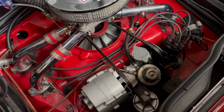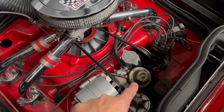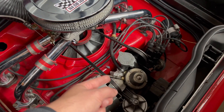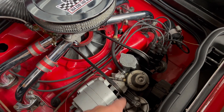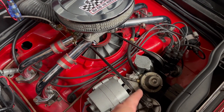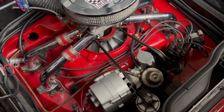The issue I have is that after two or three days this thing starts to squeak — a real high-pitched noise. I came to find out it's something about the oil or lubrication to the cam that pumps this thing. If I pull it apart and put some oil on the cam, on the shaft, on the lifter, the sound goes away for a few days, then it comes back. I don't know if there's an issue with the oiling to the cam or just an issue with this pump itself. Whatever — I'm just going to do away with it and put electric.